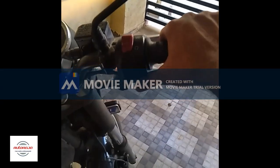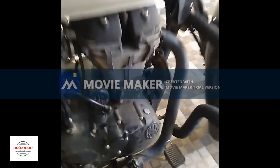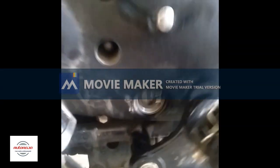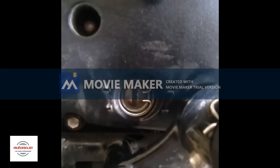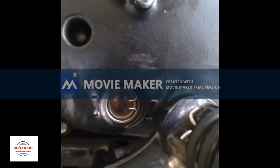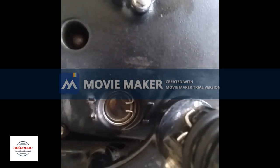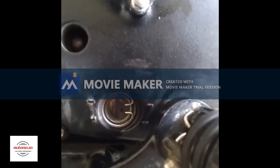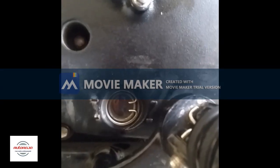Just to see the oil level, I'm starting the engine of my bike. So the engine is currently running, and now you can see the gauge. You just have to keep watching the gauge, and you can see the oil level is pumping slowly up. As in this case, I have put 2.5 liters of engine oil. It is slightly above the maximum limit, but I think that should be fine.